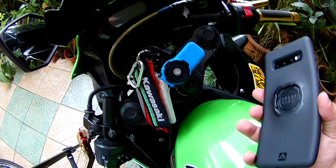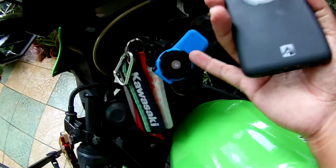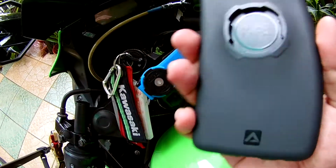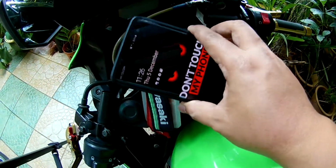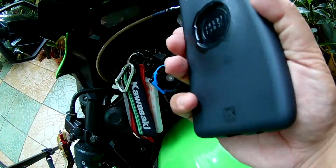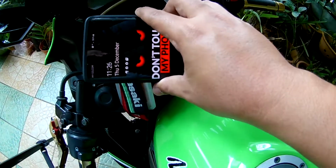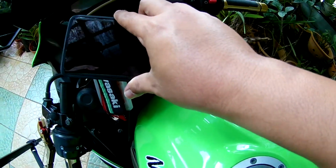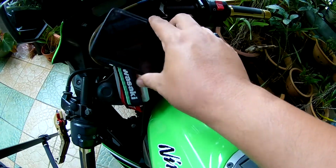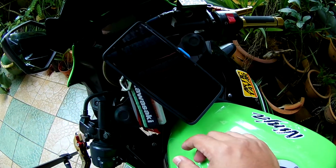And to attach again, technically what you have to do is align these notches, as you can see there, to the holes behind the case. So it's a 45 degree angle, so put it on at 45 degrees, and it's at the middle of the phone, so it should be about the same height of where your hand is. So just put it. Just now it was easier, yeah. Right, so put, and then you can feel it locks inside, and you start turning, and it locks.